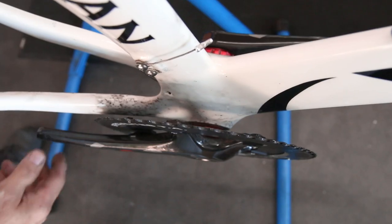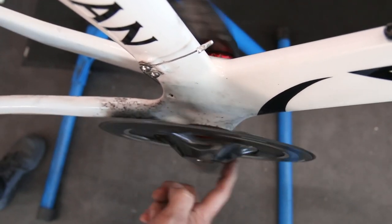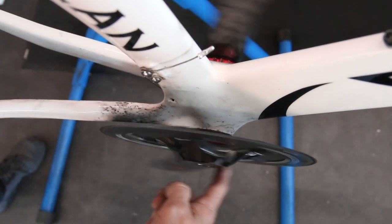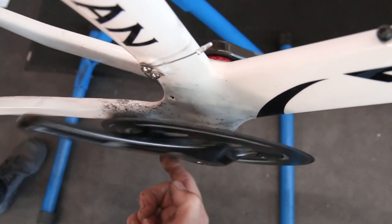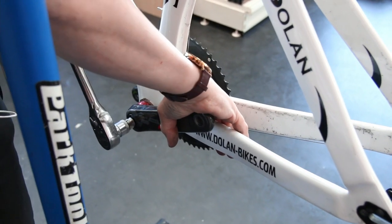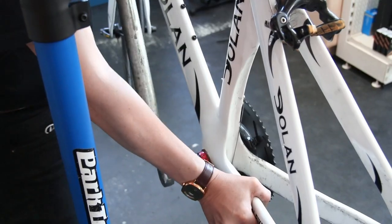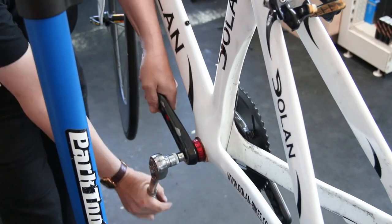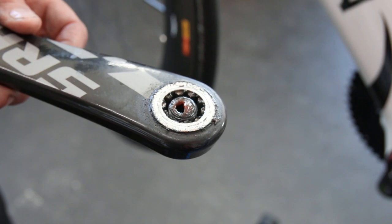You can see all this grease here, that's probably from fingers. If you look at this spinning, every time the pedal arm comes around towards the frame it's oscillating — going closer and then coming away, closer and coming away. That was because he got the spacers on the back of this chainset slightly fitted wrong. And also this pedal arm — I had to use a breaker bar on this, it was way over tightened. It was like a lorry wheel nut; I hurt my shoulder getting that one off.